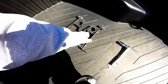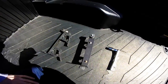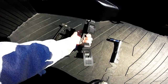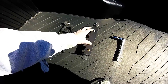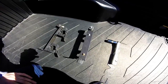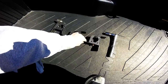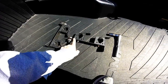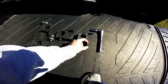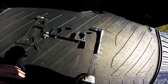To make these, you just go to Home Depot or Lowe's. You can get these in 1.5 inches. I think they have different thicknesses. Like I said, there are tons of different sizes you can use for this equipment. I went with 1.5 inches, and I want to say it's 12 feet. These are raw pieces of steel. If you have a vise grip at home in your workshop, you'll lay this piece and mount it, then hammer this down to a right angle. Just be careful not to overdo it. You see mine's just a little bent, but it's mostly straight right there.